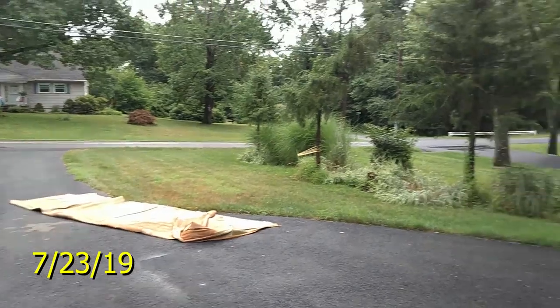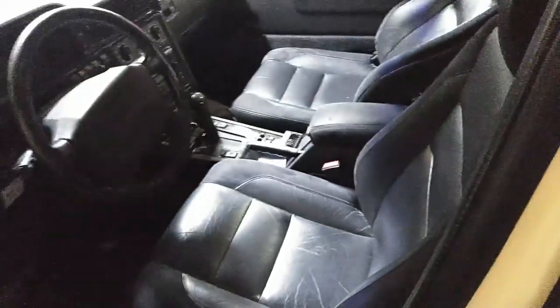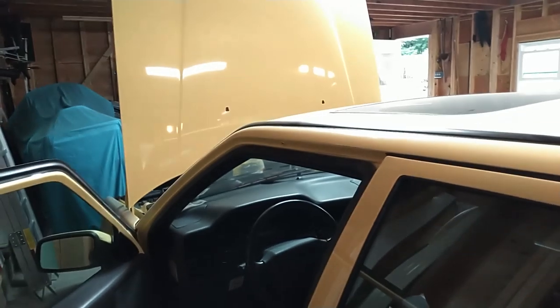Kicking off today in the big New York area, Hudson Valley. Back with the yellow 850. First thing we're gonna do is fix these seat recliners — no movement, you hear the motor going but it's not moving forward or backward; the cable slips within the sleeve. We're gonna fix that, then we're gonna replace the thermostat and the ETC on this thing.